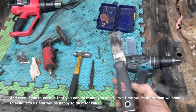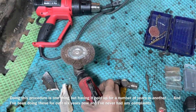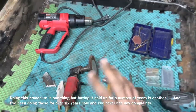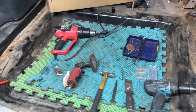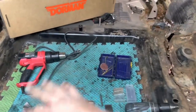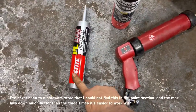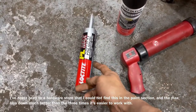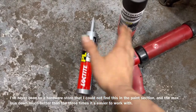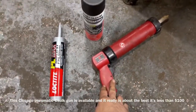I personally prefer chiseling it or removing it with the die grinder. I'm using a four-inch wheel — I'd recommend a three-inch wheel since it spins faster and takes the material off better. When you take all the glue off with the grinder and wheel, it gets everywhere, so cover the front of the vehicle so you don't find it for weeks. We're also going to use Loctite — the Max/Premium is preferable at about twelve dollars a tube versus six for the PL. I use a pneumatic caulk gun but a regular one works fine.